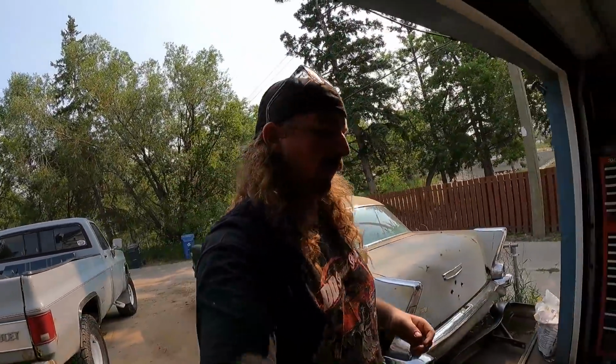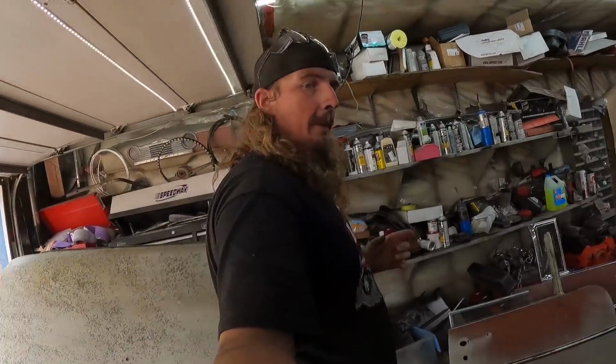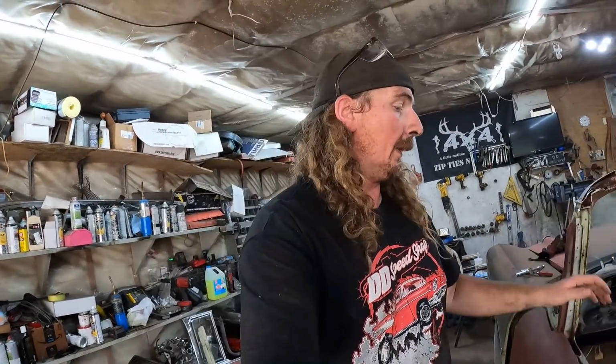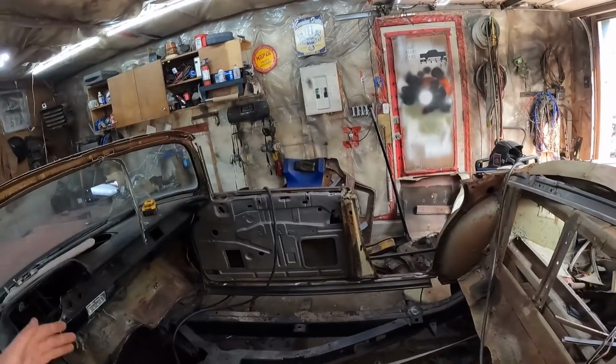This is a sedan floor, which is slightly different than a hard top and probably a convertible, but it's what they had, and it's what's available right now, and the way the world is, you take what you can get. So we're gonna put it in. I'll probably have to make a few extra mounts because there are extra body mounts, which I'll do after, which really is just gonna be a body mount and a nut and bolt, I think is all I'm gonna do. And then the hard tops had a brace that goes across the back floor. I don't know if the convertibles do or not, but that'll all be kind of down the road. So I think we should be good.